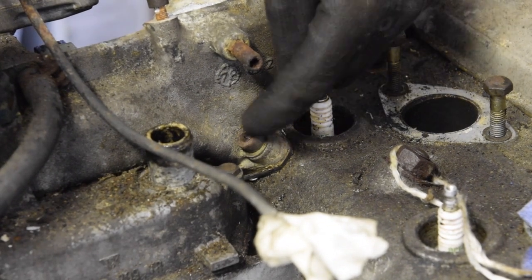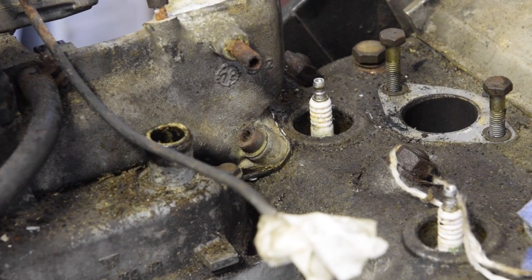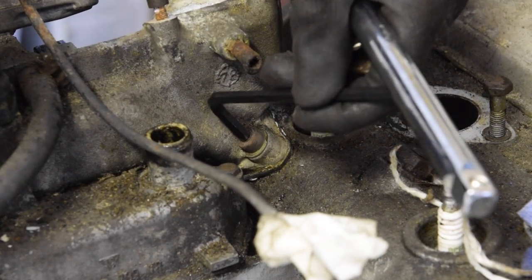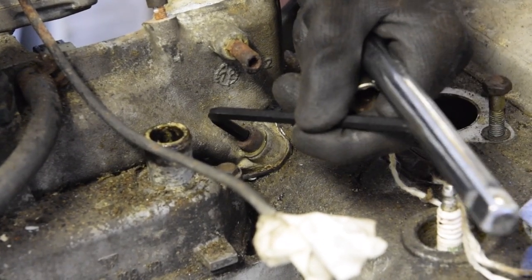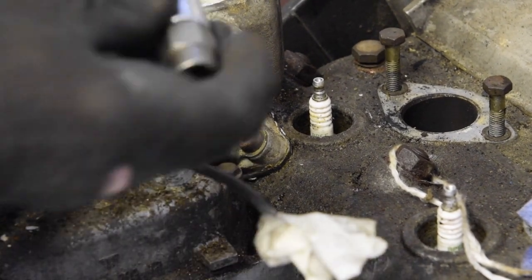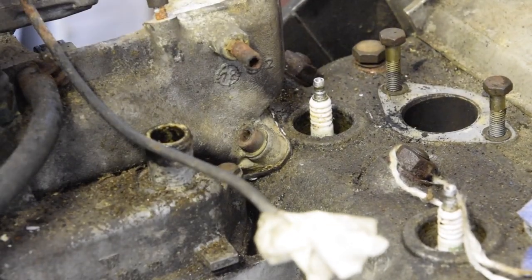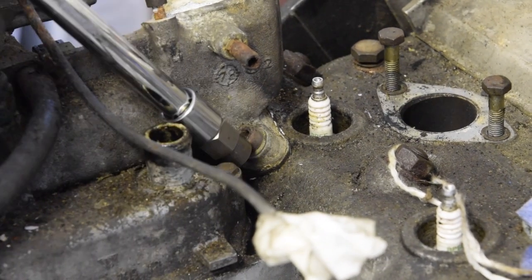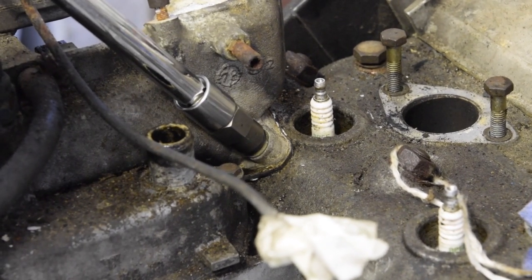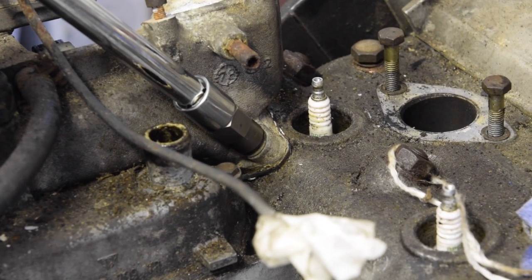I'm still trying to get out these allen head bolts — I've got three of them still stuck inside the engine. I've put a lot of force on that one with an allen key and it's got to the point where it's about to round it out, so I'm not going to put any more on it. I'm going to use my nut extractor — like that — and I can just tap it on. I've taken off a few of the extra pipes up here. If I just tap it on there and make sure it's on nice and tight, then if I zoom out you can see.